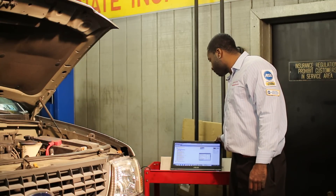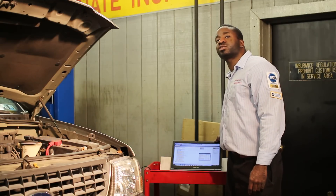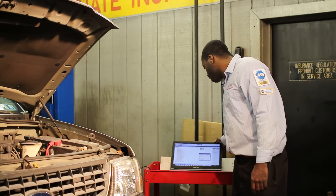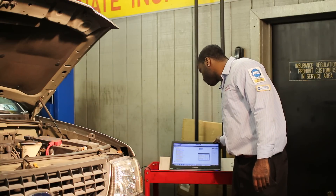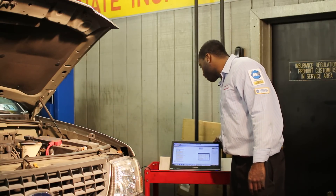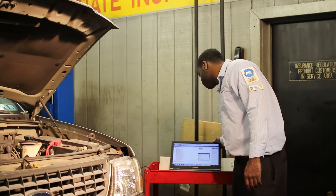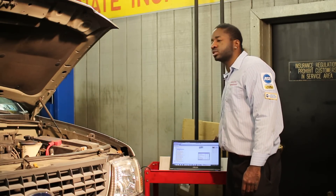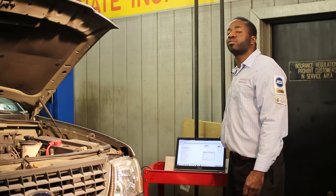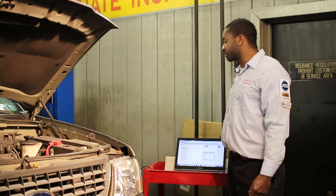During this car, we're looking at it and it was 176 degrees Fahrenheit for the coolant temperature. Also, the car's air temperature was 72 degrees at the same time. And it was under a load of 44%, which means the car was probably traveling during an acceleration or going up a hill — that's what the load basically means.